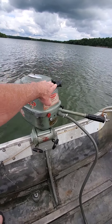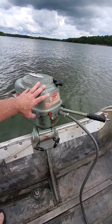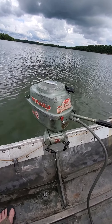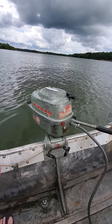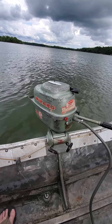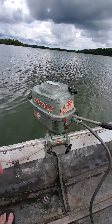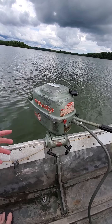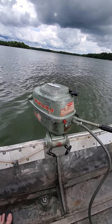The recoil was busted, the top was off, and the flywheel nut and cog for the starting system was missing. I pulled the flywheel and the condensers weren't there either — they were missing — yet the coils and points were hooked up, which didn't make a whole lot of sense.